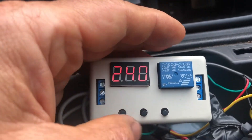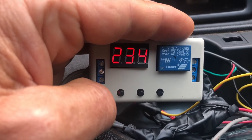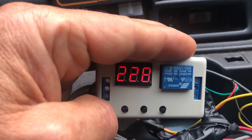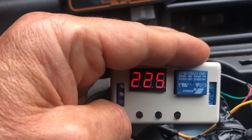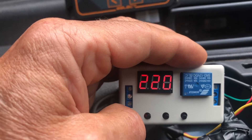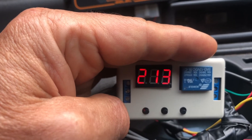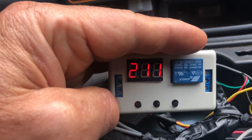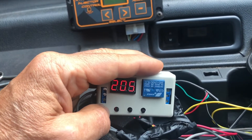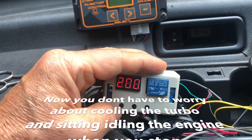Now when we turn off the ignition, the unit keeps working — counting down in seconds. In the background I can hear the water pump, a slight little whir noise, still running. When it counts down to zero, it'll then switch off the water pump. The unit itself will have its power disconnected, so it won't be consuming any power at all and won't be draining your battery, which is always a good idea. That's how to build a very simple, very effective run-on timer for an additional water pump for a turbo, to make your turbo last longer. Thanks for watching, good luck with yours.